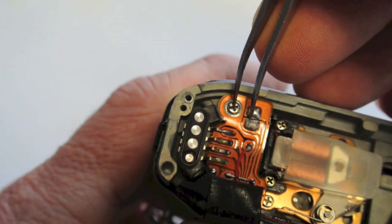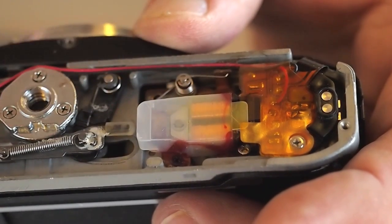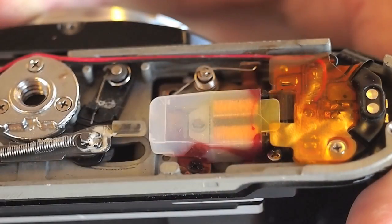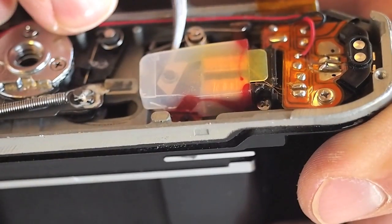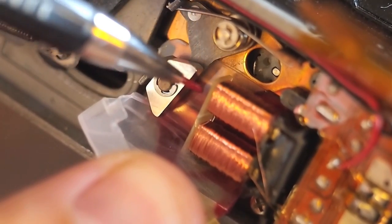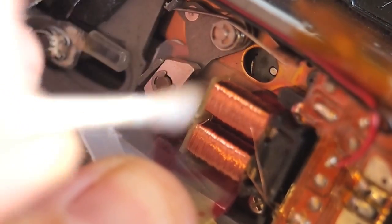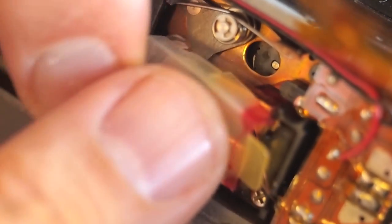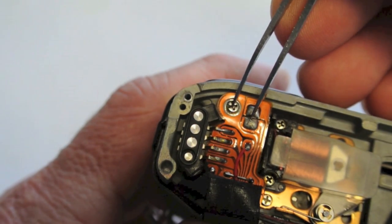If it does not release, then the next step will be to clean the surfaces between the holding magnet and the release linkage. Gently fold back the plastic covering the release magnet; this will allow access to the surfaces that need to be cleaned. Clean the surface of the latch release linkage and the surface of the permanent magnet. Use a cleaning swab dipped in 91% isopropyl alcohol and scrub both surfaces thoroughly. Snap the plastic cover back in place.